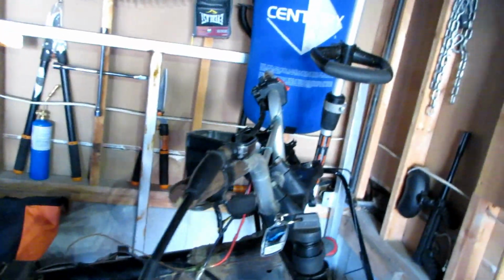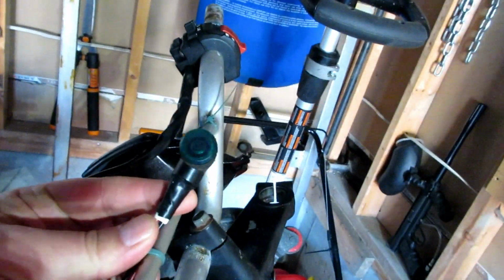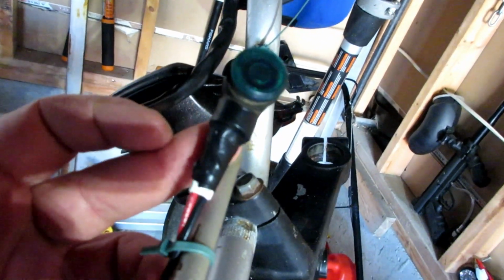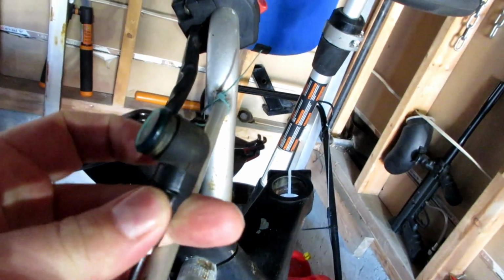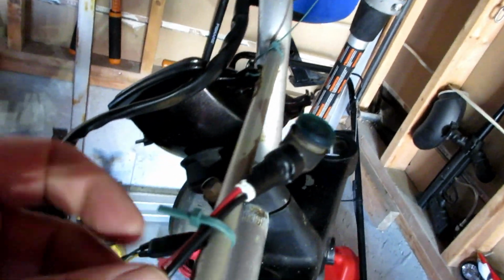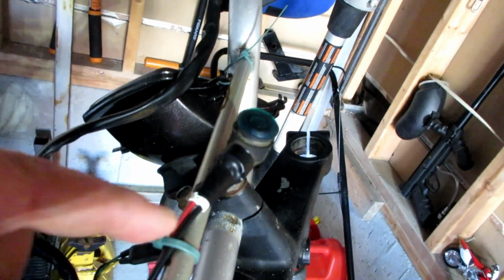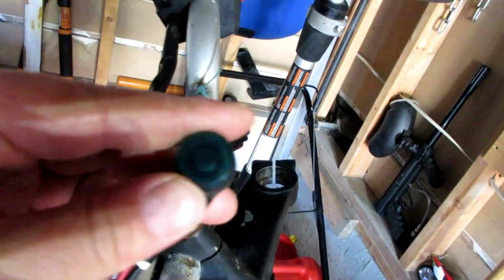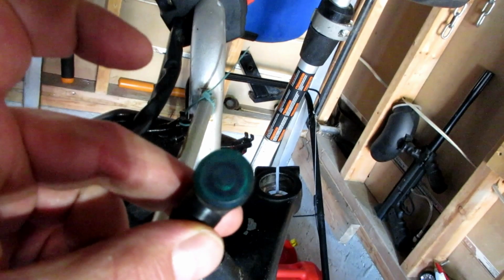Had trouble finding the neutral light, the actual bulb. I have the neutral light in assembly, so I went to that same electronics store, kind of a depot of electronics, and they had a 12 volt neutral light or green indicator light. So that's on a tube, that's up in there. It's LED, so it should be bright and will illuminate that fine, but I just wired that in there.